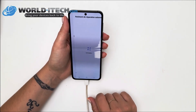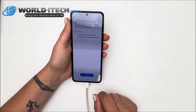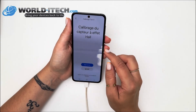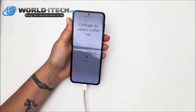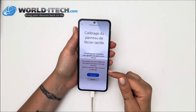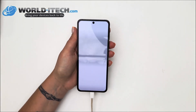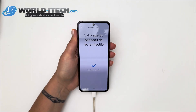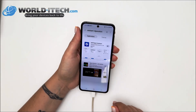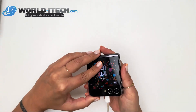Open the self-repair assistant application and follow the instructions. Press continue to start, then on the next screen press next, then start. The first calibration will now start. Press start again to calibrate the touch screen and the screen will turn white for a few seconds. Above all, don't touch the phone. The screen is now calibrated again. Close the application, return to your home screen, then test by closing the phone and pressing the power button to see if everything's working properly.